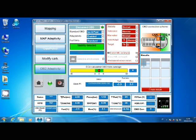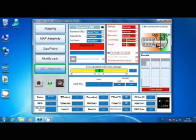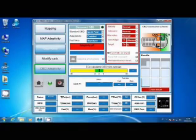Now I turn off the engine. So basically, if he takes a look at the switch when turning on the key, he will see the diagnosis LED blinking for some seconds. When it stops, the gas ECU is already connected with the OBD system and has already sent a DTC error erase command. Okay, so let's try this. I turn on the key.